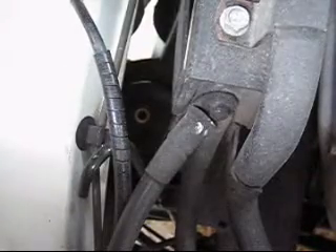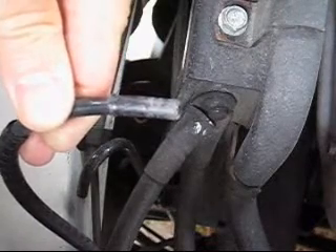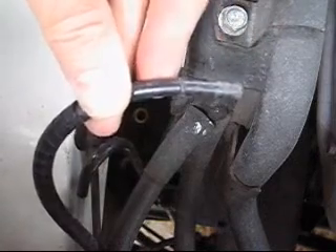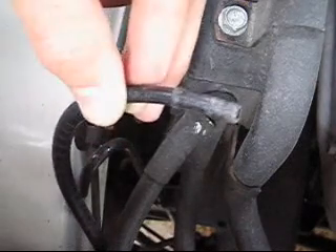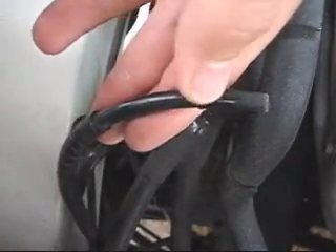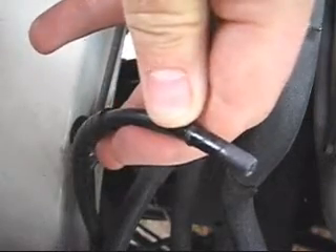Now we're ready to inspect the actual hose. Here's the high pressure line. You can see it's kind of dirty, but you can also see two rings that are slightly clear — one and two. Those two rings are marked from the O-rings inside the actual airbag. What I would do is take a little bit of Teflon and wipe it down, clean it up. After cleaning the end of the pipe with a Teflon-sprayed rag, what we're looking at is not dirt — these are actually scratches and abrasions over the years.